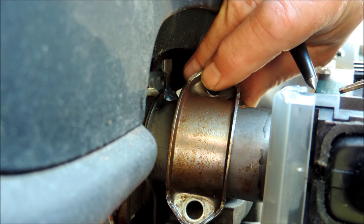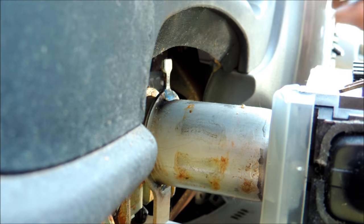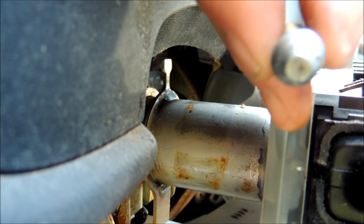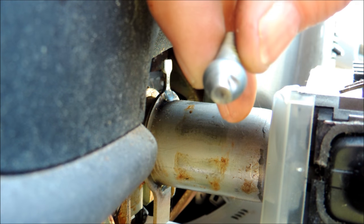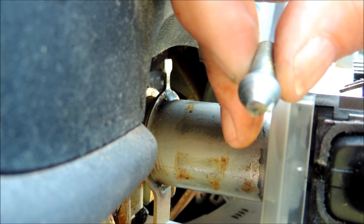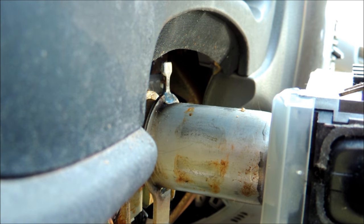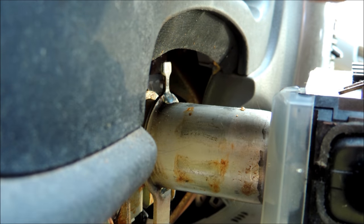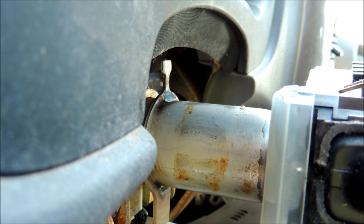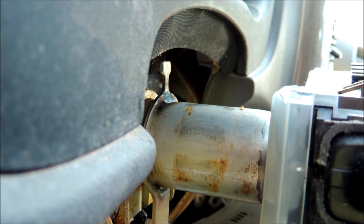There you have it — the lock's out. That's how you remove these. Here's the top of the security bolt; you can see I just tapped at it. All it needed was a small hammer, my fingers, and a small sharp punch — the smaller the better. And off she comes.